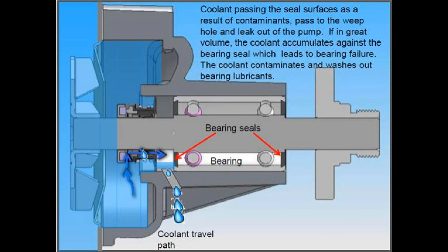This is a typical water pump here — this is not necessarily an exact Cummins replica but it's very similar. What you have is a grease sealed bearing. The old bearings used to have zerk fittings on back pre-1960s or so, where you could actually put a grease gun on it, but now they're like most bearings on vehicles — just a sealed bearing. On the other side you have the coolant; that blue part on the left side is the coolant, and there's a seal there also.